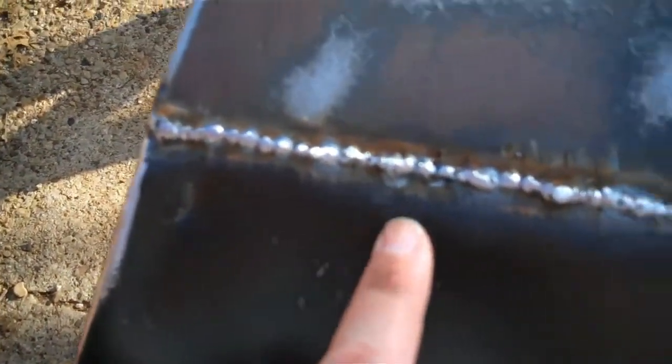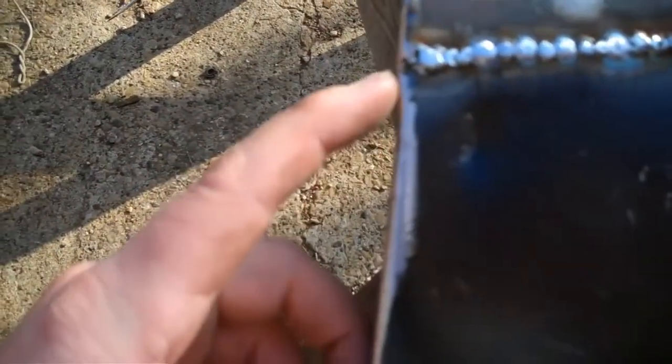Like I said, just jump around, spot welds, just, you know, effectively random places, and don't heat up the metal too much. See, I just got done welding this, and I can put my bare hand on it. It's not too hot. And here on this edge, you can see I ground some of this E-coating off of the panel here, and I think what I'm just going to do is do some stringer beads in this area.